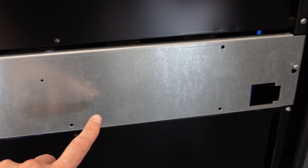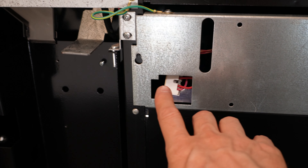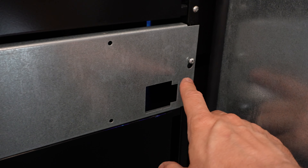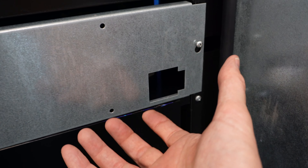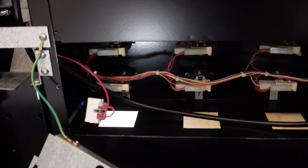More often than not on these live fronts, the way these buttons work there's a connection on the back of the switch. I'm going to need to remove this panel to get to the selection button. I've removed the Phillips head screw from this panel and loosened the one over here — the eyelet design allows me to just lift it up and let it hang down, giving us access to our selection buttons.